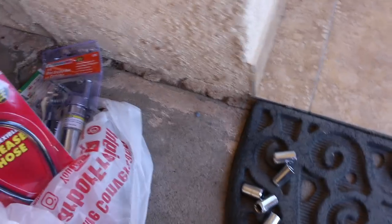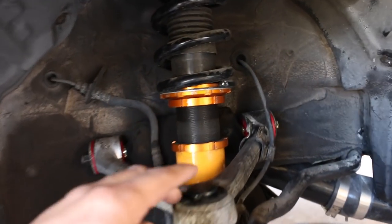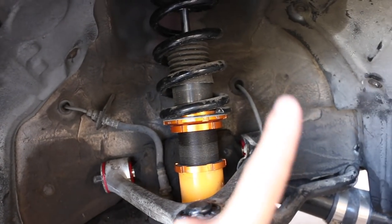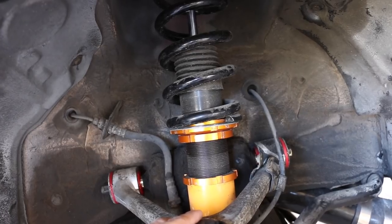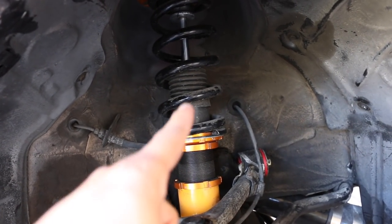One of the last parts to this is to remember to grease up your lower ball joints, because the brand new knuckles do not come lubed up. Another thing I want to talk about - you can see this darker part here - these are my 240 eBay coilovers, link in the description. A lot of guys have asked how these hold up and how they ride. I said right off the bat that out of the box they are very soft - the front of the car was really bouncy.